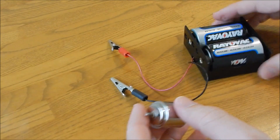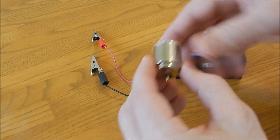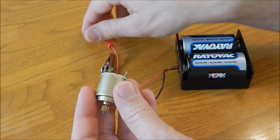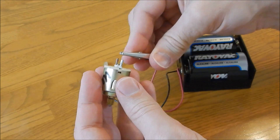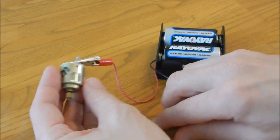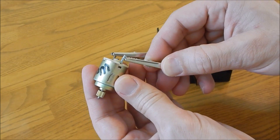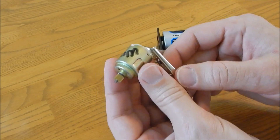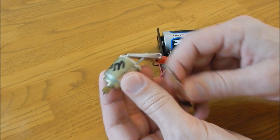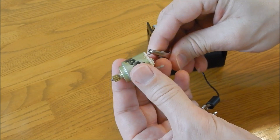That's all you have to do to test a motor — that's a good motor right there. This larger motor has a little more noise to it, but this smaller motor I took out was starting to go bad. You can tell that the bearings and bushings inside are going bad because it sounds like metal grinding. Definitely not a good idea to keep that one in there.